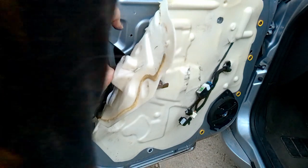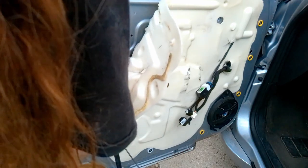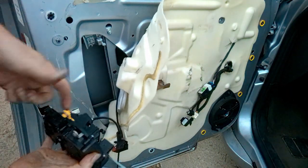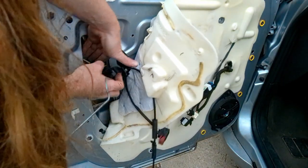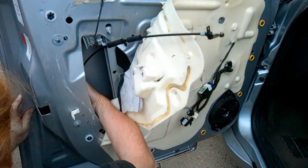So I'm taking this opportunity to talk to you more about things. But yeah, the reason I had originally just replaced this rather than try the repair that some other YouTubers have recommended, like spray a bunch of lubricant and take it apart and do this and that: Chevrolet had updated the part, and some of the insides are different. So, like I said in the video, I did not want to keep dealing with that as a problem. So I just went ahead and bought the updated part. Now, if you buy one aftermarket, you might not be getting the updated changes. So that's why I do recommend you get this from a Chevy dealer. I know, they call them the Stealerships.